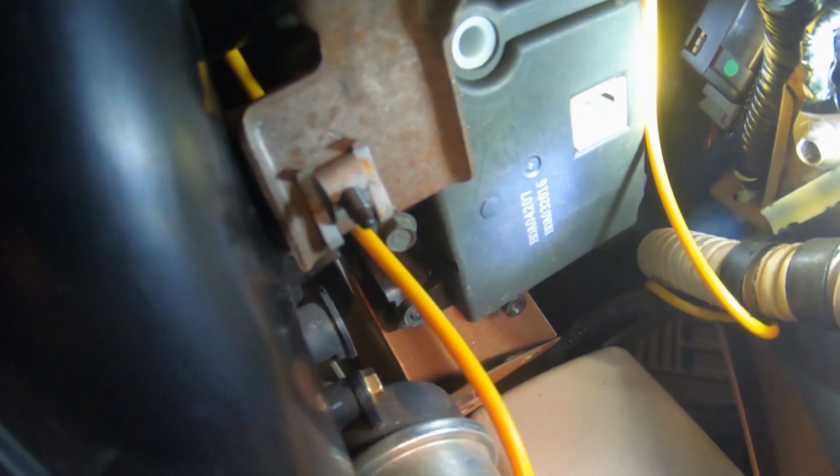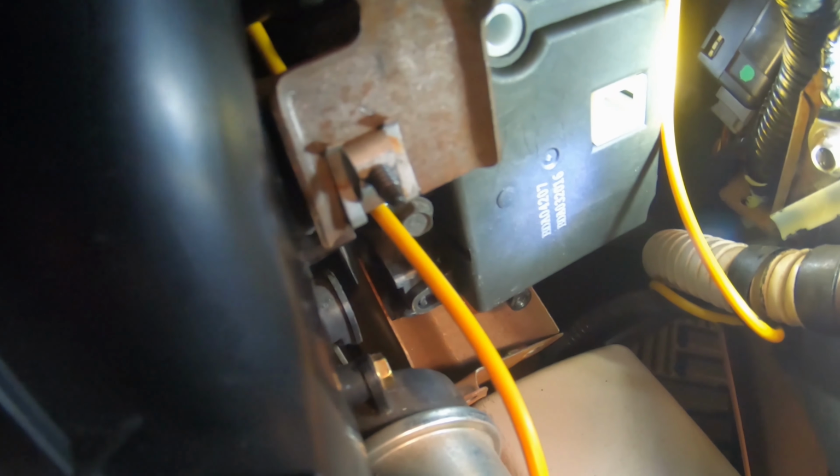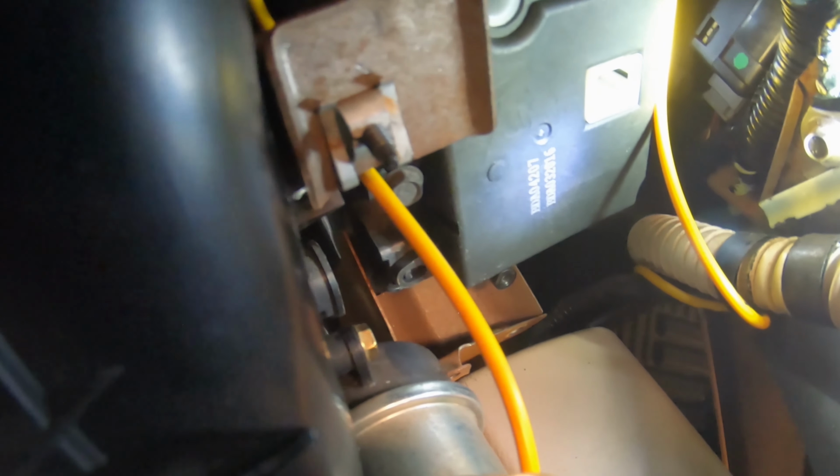And we'll just start getting it all fastened back up. Before I go tightening any of them, I want to get another one or so started. Be sure it is lined up. Then start tightening it in and then worry about the other ones. There's two started in diagonally across from each other, finger tight. And then I'm going to put one more in. And remember, I'm leaving those loose right now. Two of them have that metal cover over that vacuum actuator that's just laying down out of the way, but I don't want to mess with that one right now.